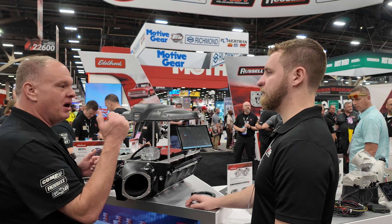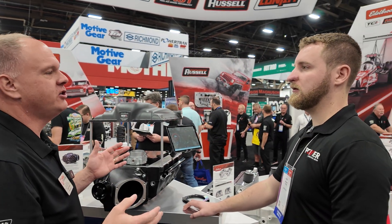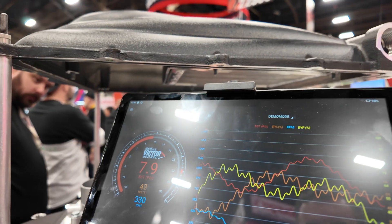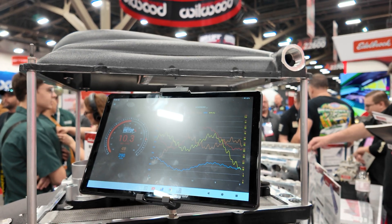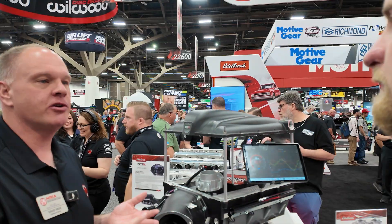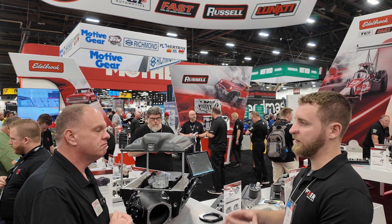For those who struggle with technology, it's super intuitive — it'll be a free download for Android or iOS. You can put it on a tablet or phone, go into the menu, and set the parameters for how you want to control the boost. The app also lets you monitor intake air temperature, throttle position, and engine RPM, so you can just throw a phone up on the dash and have all your gauges right there without wiring up extra things.